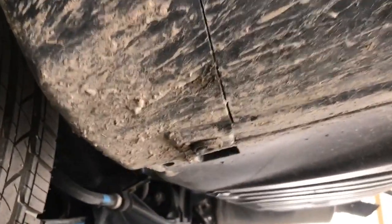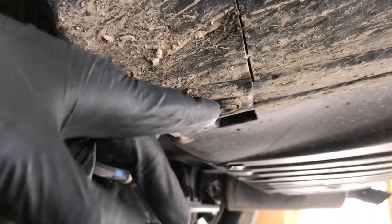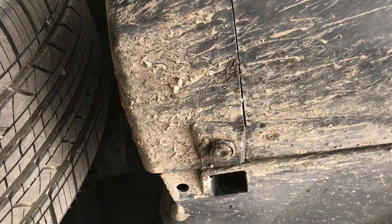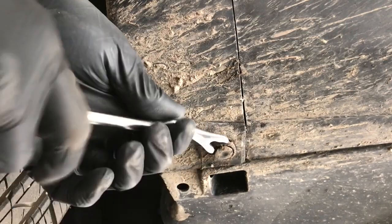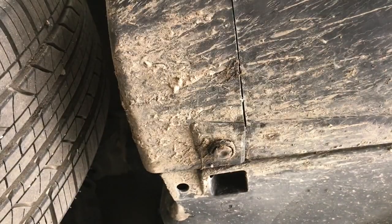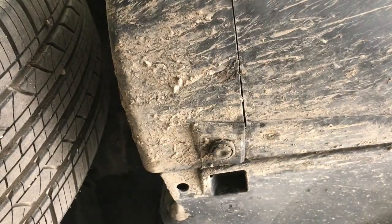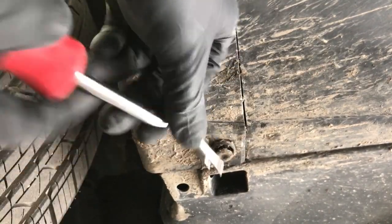And then come around to the back of the molding. Underneath here is a bumper clip that needs to come out. To get that out you can use a flathead screwdriver or a clip tool. But the trick is, especially the ones here on the bottom — they get really grimy — so you want to work your way back and forth prying out on it, and typically you can get them out that way without breaking them.